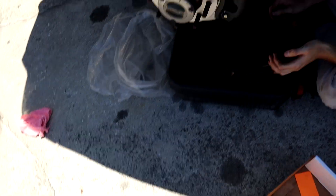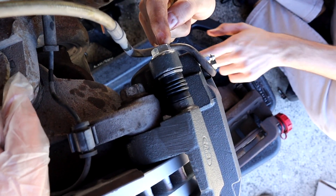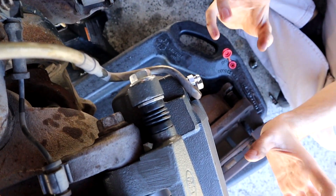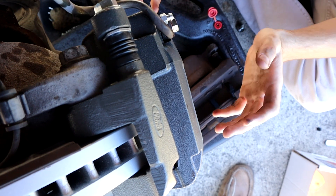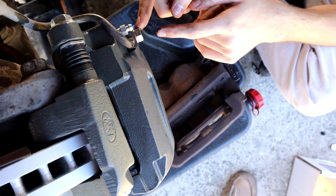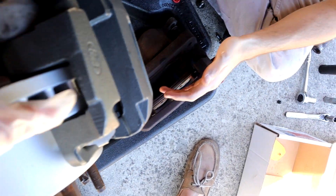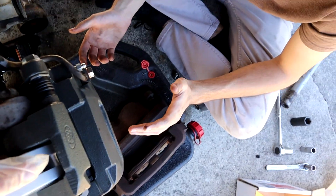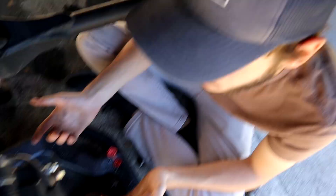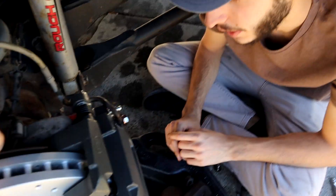I think with that jack we can take both rear tires off at the same time. So this bolt right here comes off and disconnects this part of the caliper — if you want to just change out your brake pads, you can technically just do this bolt and the matching bolt lower, pull the caliper off, put new pads in, compress the caliper and put it back on. That's pretty simple. To change everything out, this is the brake line bolt you undo. I took out the big bolts and pulled the whole rotor off at once — it's really simple. There's plenty of online tutorials, which is one reason why we didn't do one.